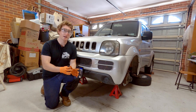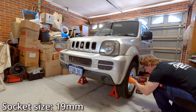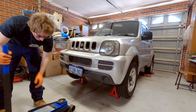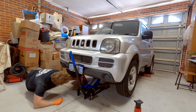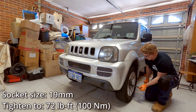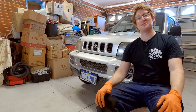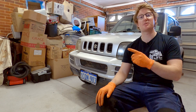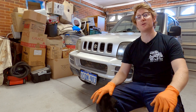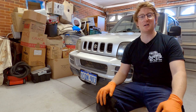I've just finished doing the job on the other side and got it all back together — pretty quick once you've done it once. Now it's time to put the wheels back on and get the car back on the ground, then torque all the wheel nuts up to 72 foot-pounds or 100 newton meters. That's it for today — thanks for watching. If you enjoyed this video you might want to check out episode 3 or episode 5 of our Jimny restoration series where we did a full swivel hub rebuild followed by changing out the leading and trailing arm bushings as well as the tie rod and drag rod ends, all of which are candidates that can help contribute to steering vibration. If there's something you'd like to see in a future video we'd love to hear it in the comments below — otherwise we'll see you next time.